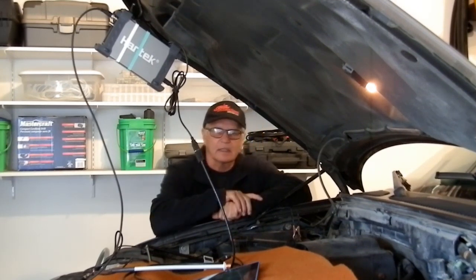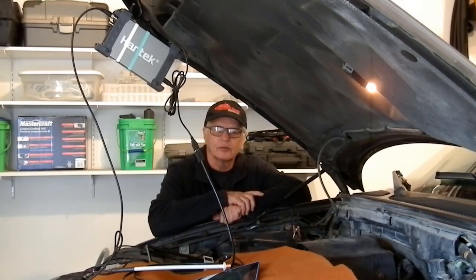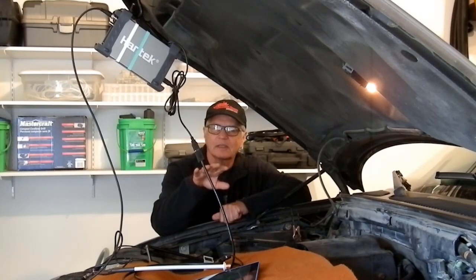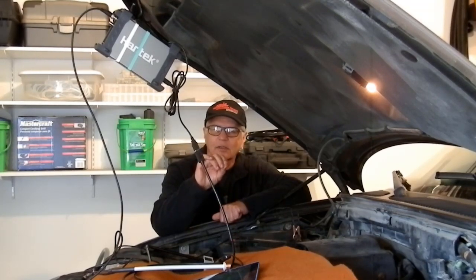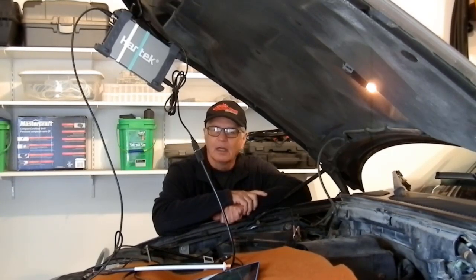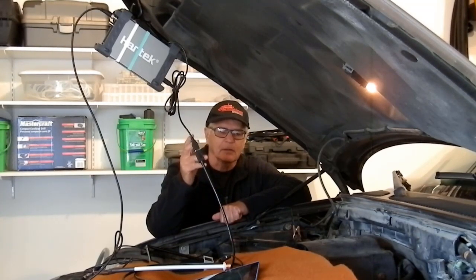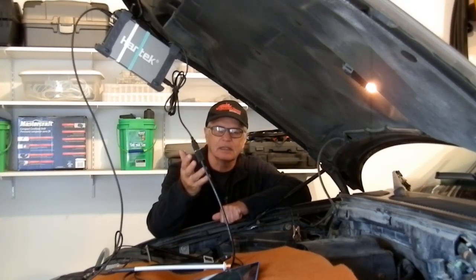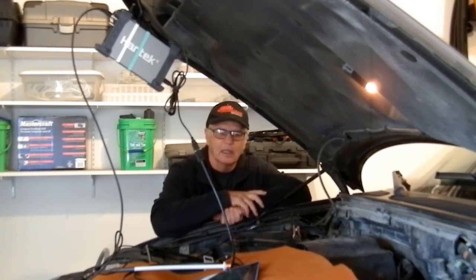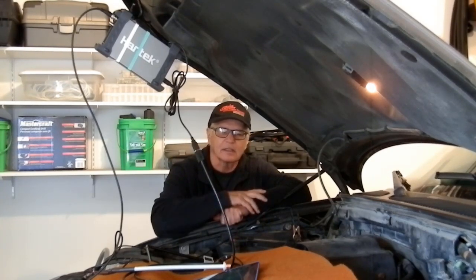When I did my research for all of this, somebody was saying that the later model coil-on-plugs had more insulation and that trying to get a signal with a paddle or homemade devices was a little more difficult. In particular, one guy was saying he had a Ford Fusion 2011 and it was particularly difficult to get a secondary waveform using a probe like this. I happen to own a 2011 Ford Fusion and I did try the probe on it — no problem. I get the same multi-strike pattern. The probe performs the same way on that later model vehicle as it does on this old 2002.